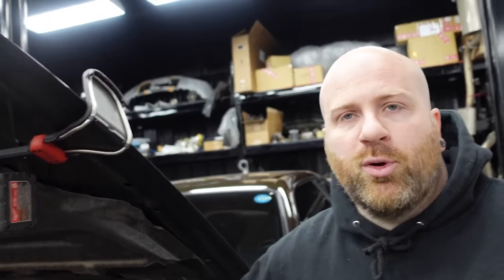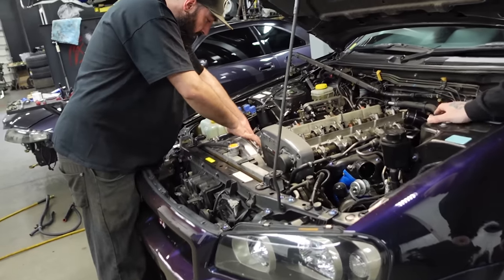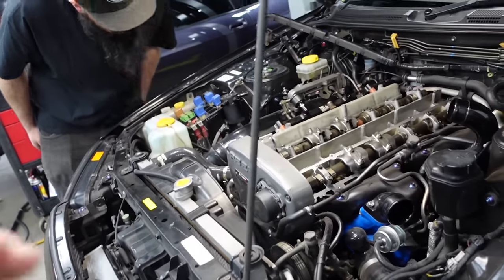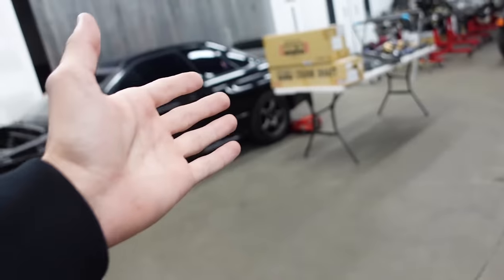It's OEM. So we would put a Nismo head gasket and head studs and make it slightly better. But the whole plan that Tommy and I had — we were going to go from a 2.6 and do the HKS 2.8, throw V-cam on top of it as well, and completely ball out and build a really cool motor. So now we're pressed with this uncomfortable decision — I've already purchased all of the parts.